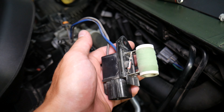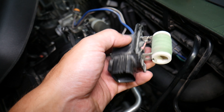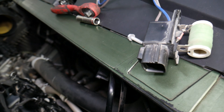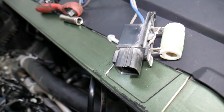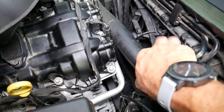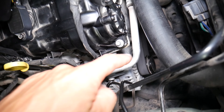There's one hidden device integrated in the radiator fan known as the radiator fan resistor. This is very important for the normal operation of the radiator fan. If that resistor fails, your car can actually overheat easily, because it's practically responsible for turning the fan on and off and controlling the speeds. We have a special video explaining how to replace the radiator fan resistor on the Dodge Challenger — it's located right here behind that connector in that hole, and it connects directly to the fan motor.